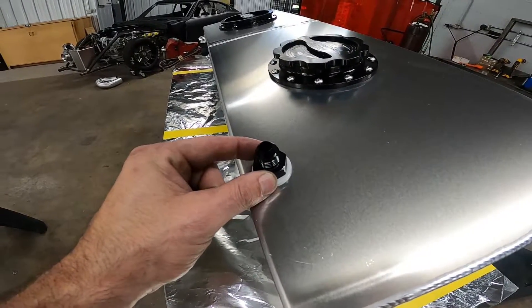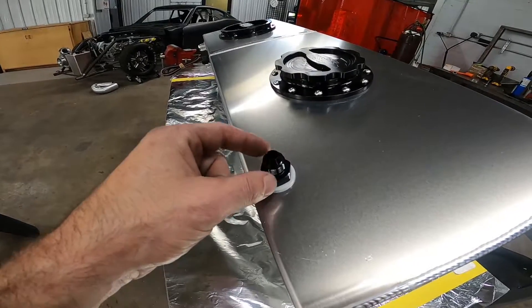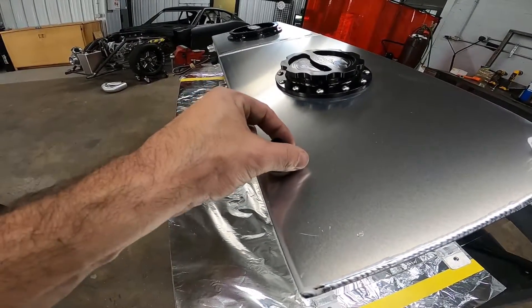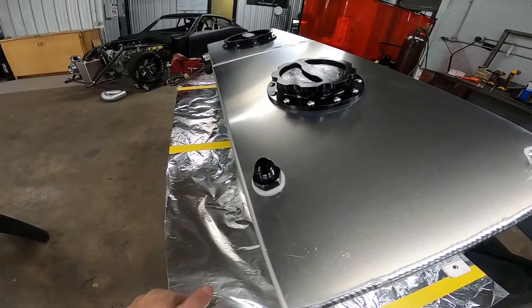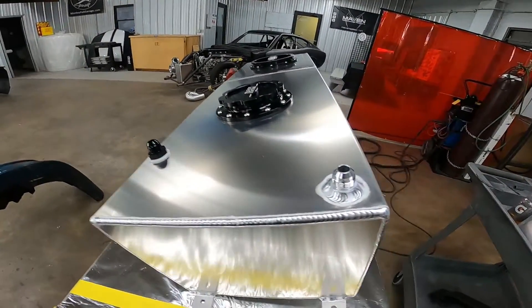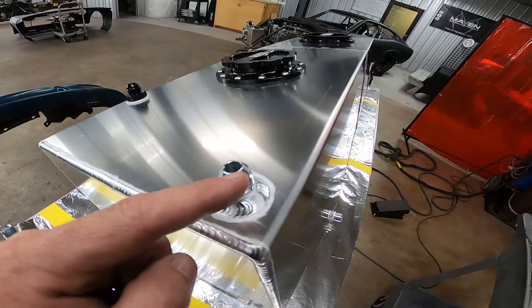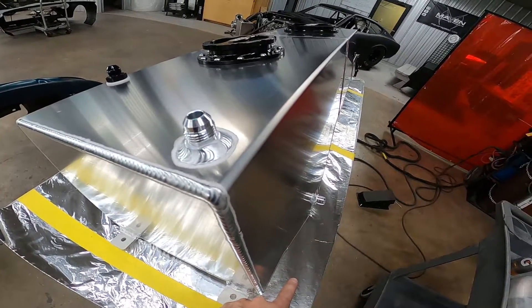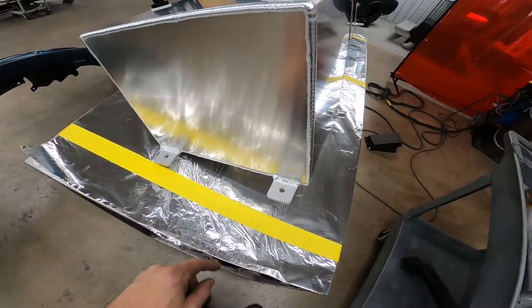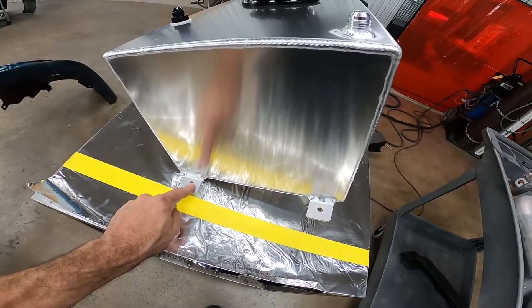You can drill on the side and put your strap across, or whatever you need to do. These all come standard with a number eight vent — this is a Vibrant-style rollover vent with the ball inside. It's a bulkhead style so you can unscrew it and take the inside out if it were to ever go bad. We've got the return on the back corner because most of the time your fuel lines are going to go down into the trunk area. Hold-down tabs sit on the driver's side frame rail.